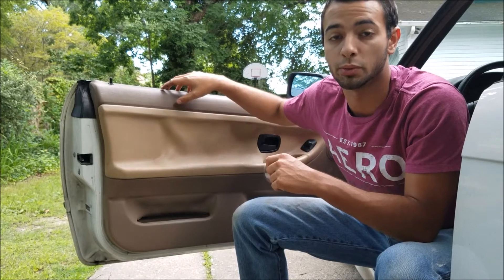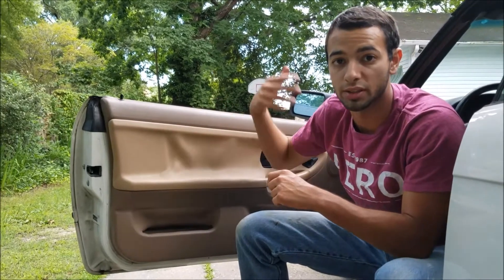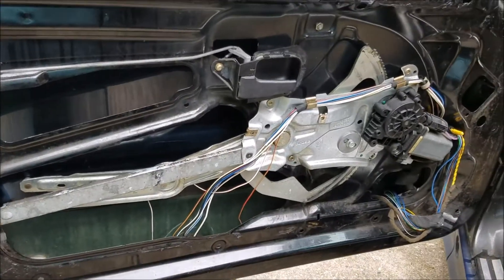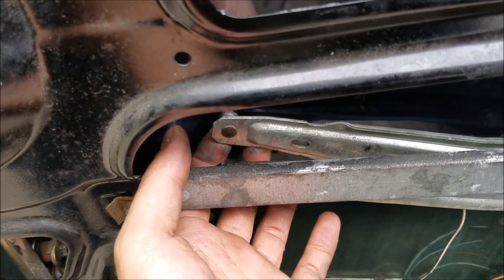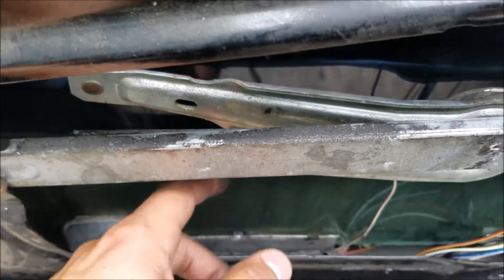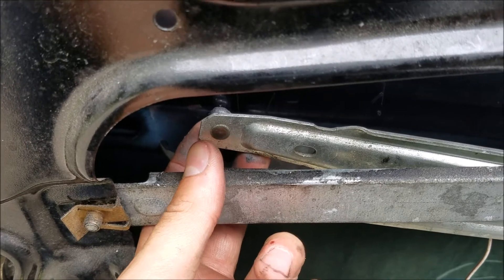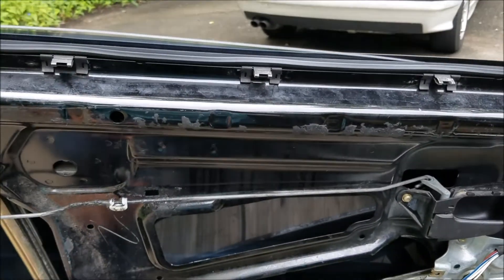When it's raining outside, he raises the window up all the way, and when it's not, he'll lower it to get some air flowing through. So that tells me pretty much that the regulator's not attached to the window at all. Once I pulled the panel, it was pretty obvious what was wrong. The regulator had slid off of the plastic pieces, which are located right here — they had just cracked over time. There are two ends like this on the regulator, and they're both off. So basically, the window's just free-floating here — I can pick it up and move it around.